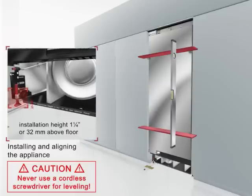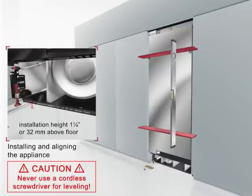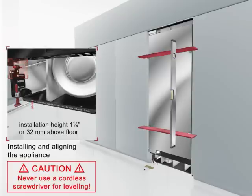Now, level the appliance to the specified height. The front feet can be height adjusted directly with an open-ended wrench. The height adjustment of the rear feet is actuated from the front end with a manual hex nut driver. The rear feet are elevated by a flexible shaft. This rear adjustment is made easier when the unit's weight is unloaded at the rear. Never use power tools to drive the hex nut driver for the height adjustment of the unit.